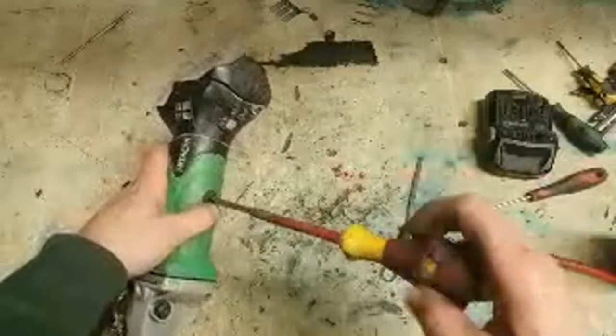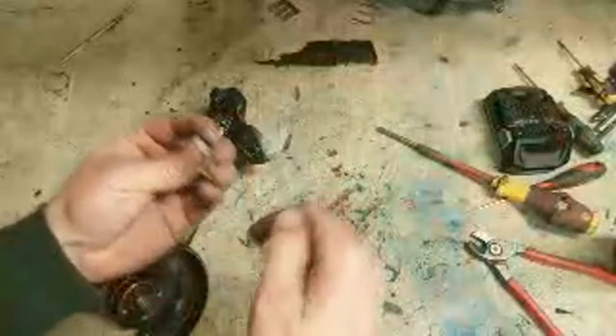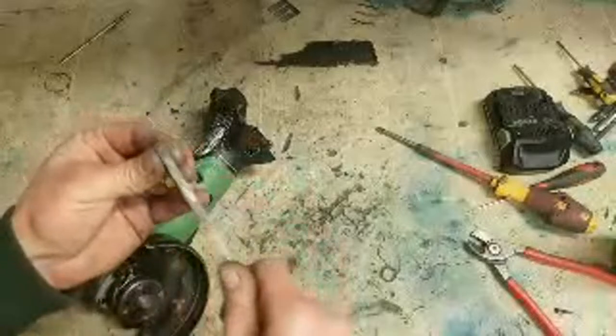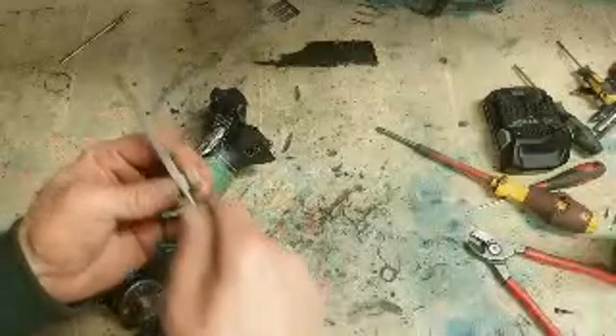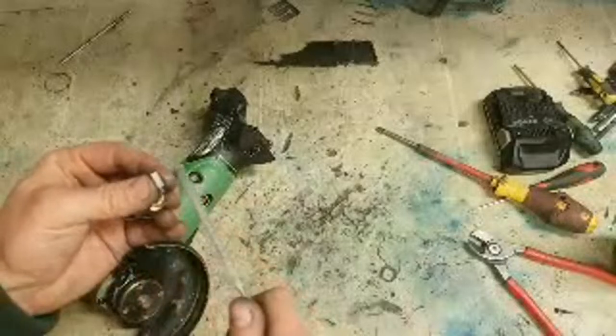So you have to watch when you're repairing them, because most people get too used to them, especially these brushed ones. They overuse them for everything. They start getting a lot of work. Brush motors get hot. These run very fast. You can overheat them very easily. Motors then start to work harden, copper gets more resistance, and the more you're using them, the faster they're getting hot. So they're more inclined to burn out. When you get them in for repair, you really need to be sure the motors are all right. Because they're that small, you can't really test them either.